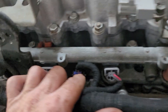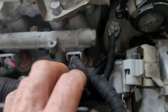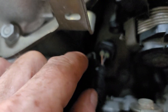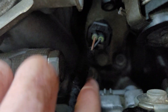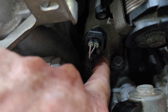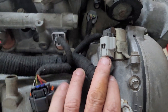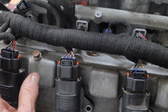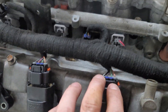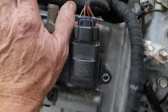All of your injector connectors have been replaced. Your cam sensor connectors, or post cam sensor connectors, have been replaced. EFI water temp sensor — you've got another connector in here that takes a water temp sensor from a Toyota. You'll see just underneath the EFI sensor there's a little stopper plug; you can literally screw that out, screw in a Toyota sensor and it'll plug straight in, making everything watertight. Your oil control valve connectors have been replaced and all of your coil connectors have been replaced — it's a typical thing with the 1UZ VVT; all of these connectors tend to go bad.